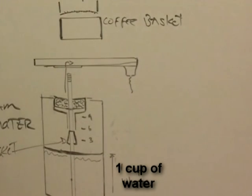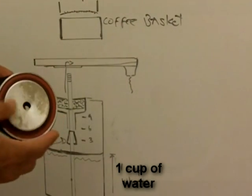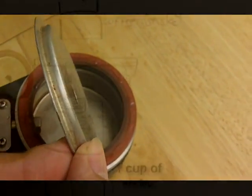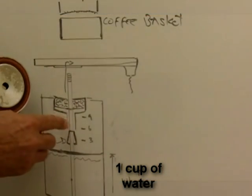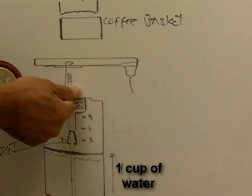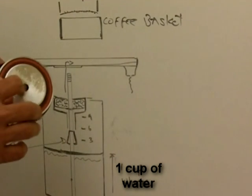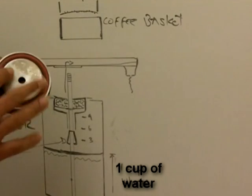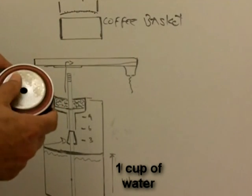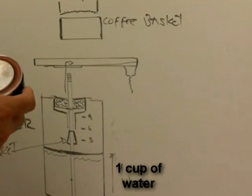Another situation is I'm not sure this upper filter is supposed to be concave like this. With this shape, what's going to happen is you'll have some steam and liquid concentration in this area, especially if it's not going through the coffee, because this is not going to seal against this edge. Maybe someone could check their machine to see if this part is supposed to be flat or concave. My guess is it's supposed to be flat, and because of the pressure when you tighten this piece, it has changed its shape. A gasket here made of the same string material would probably make a great difference.